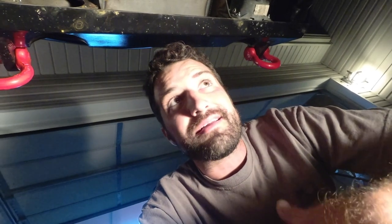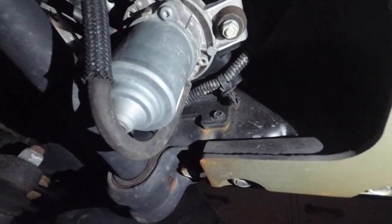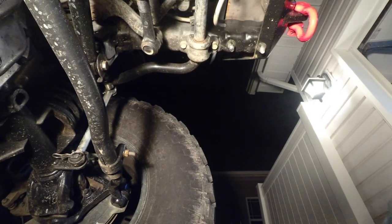New game plan — I'm going to do mine exactly like my wife's. I'm still going to get plenty of clearance and I'm just not going to worry about it. Cut my finger. The fog lights are in the way, and the brake lines that go across here are in the way. So I'm just going to make mine vertical instead of horizontal. I thought I could fit it in there and I'm sure I could, but doing it horizontal is a pain in the ass. I did hit the holes I drilled with some Rust-Oleum black paint. I'm going to go ahead and get this up here and install it the way I probably should have from the get-go.